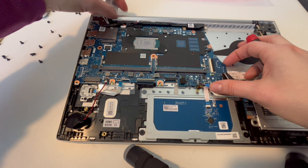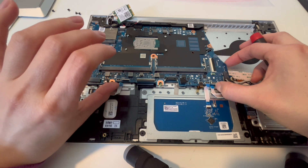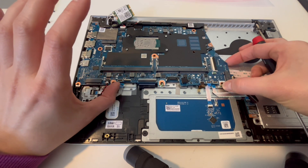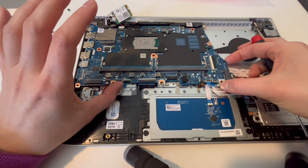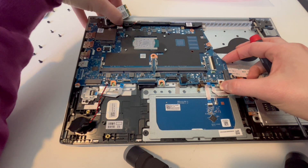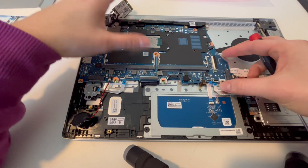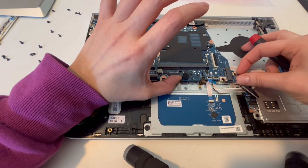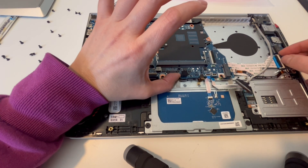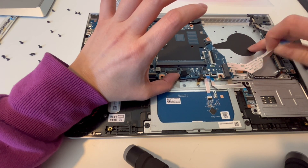As you can see, I go to pull it up and I meet resistance. I see some wires here — I'm pulling but still have resistance. Instead of pulling harder and bending the motherboard, which can break it, I examine why it's not coming up. I move the cables, but it feels like more resistance than just a tiny cable. And then I find it — right here, this long ribbon cable that I missed. That's causing the problem, so I go ahead and unplug it and pull up.